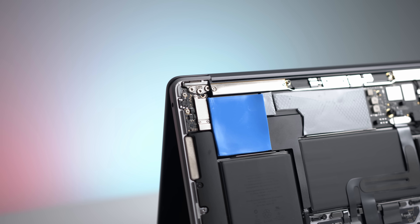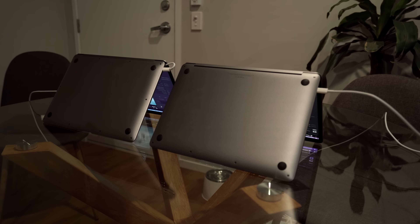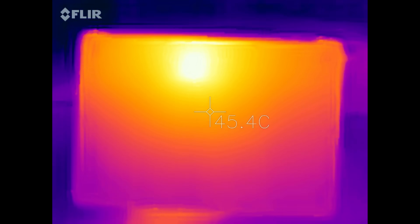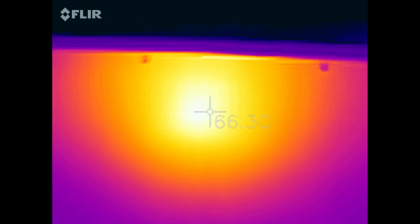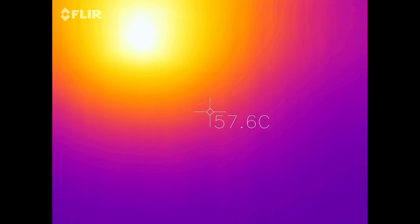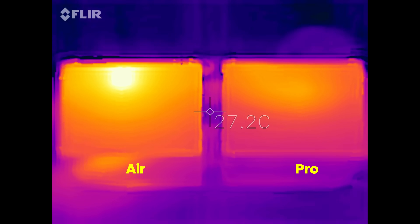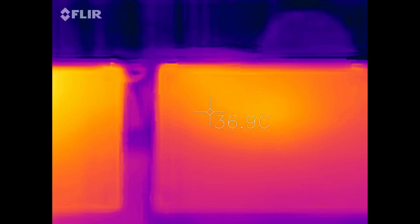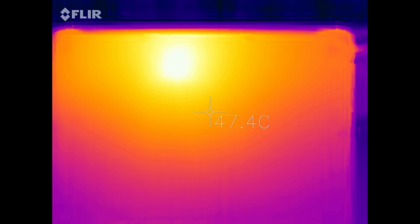A lot of comments asked why Apple didn't include this at the manufacturing stage. The answer is simple: it gets too hot. It gets way too hot for lap use. You're not exactly going to burn yourself, but if you have your hand or thigh on the back of that Mac while it's rendering at close to 60 degrees Celsius, it might take 15 to 20 seconds but your skin will get some kind of contact burn. Apple definitely does not want liability for that, which is why they did not include this. You lose about 10 to 15% performance, but the back chassis remains relatively cool even under heavy load like rendering 4K or 8K video.